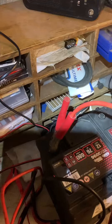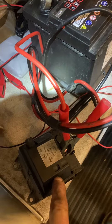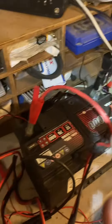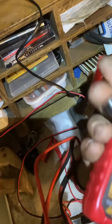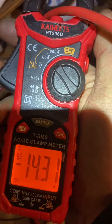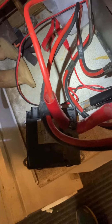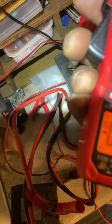I'll take my amp clamp here. I simulated what was happening — I had a positive going to terminal one below here, because it heats up the wall inside. I imagine they might be getting a wee bit hot there. I've got the amp clamp set to DC. It's gone orange — it's drawn 14 amps. That's the problem: this thing was drawing amps constantly, draining the battery.